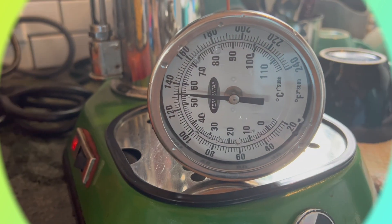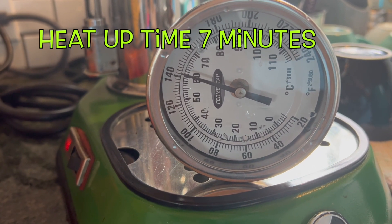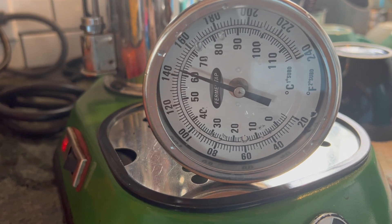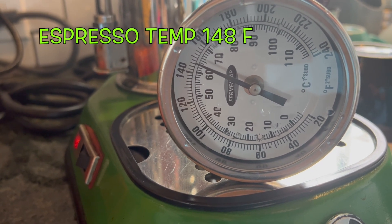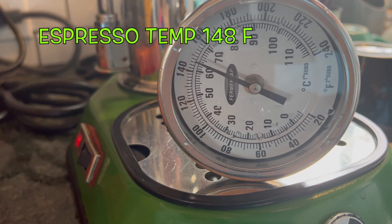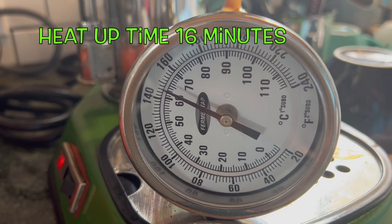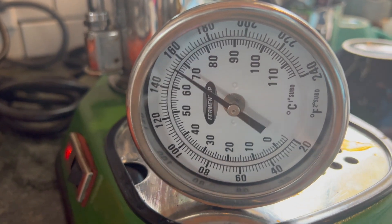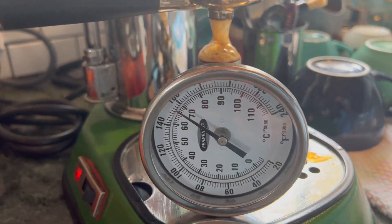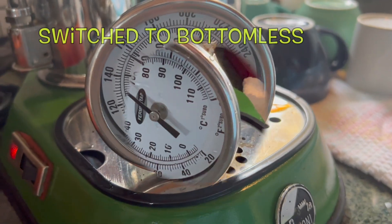Let's keep going — Miss Green Jeans, 7-minute heat-up. It does its big burst, drops down to one bar, then we pull. First pull: 148°F, cooler like all the machines — maybe why people prefer the first pull with a dark roast. Up to 16 minutes: 158°F, just under that perfect 160. Each one isn't perfectly identical, and this one may be a little watery at the end.